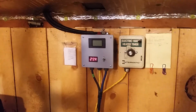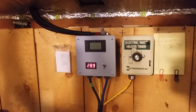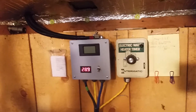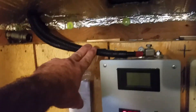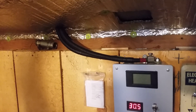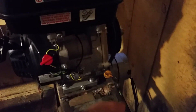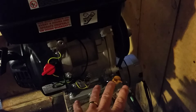It's the issue of modern alternators. They figured out that the best thing to do is put what's called a battery voltage sense wire. Now if I have a standalone alternator with an internal voltage regulator, it's going to start pushing power to your batteries through your battery cables, systems, run relay, and junction. If the voltage sense wire is reading from the voltage regulator right to its output terminal, that's as far as it can see.